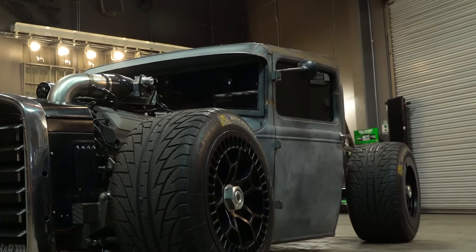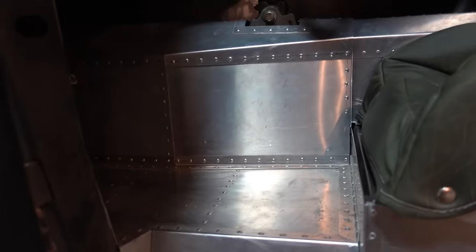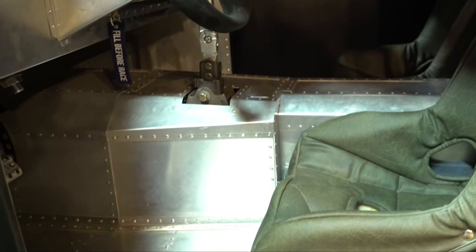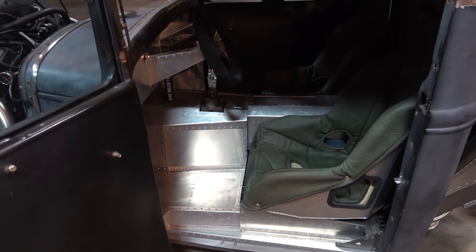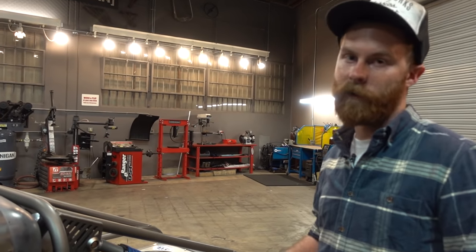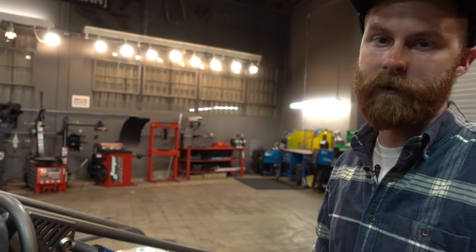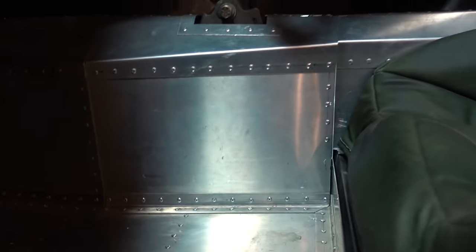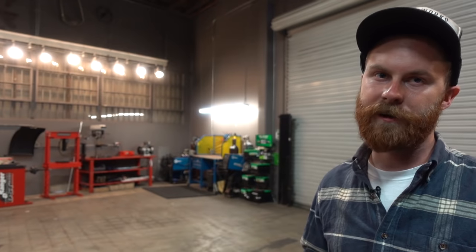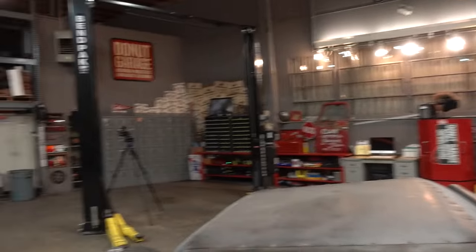It fits — it's really not too bad. You have tinted glass as opposed to window tint on the glass — that's what came in the doors when I bought it. This tunnel is massive. The transmission is a Jericho WC44, a four-speed dog box — straight cut. The biggest reason I went with that transmission is, although it's a sweet transmission that can hold a ton of power, I needed the room. The six-speed that came with the Mustang ate up even more room and made it impossible to fit pedals in the truck. The truck itself took me five and a half months start to finish, working only after hours — and if you know what you want and know what you're going for, you get it done.